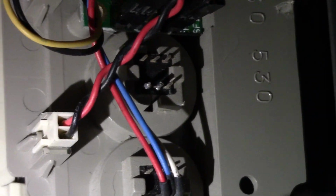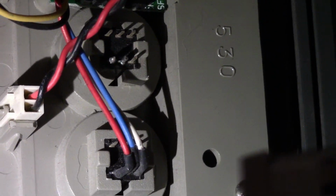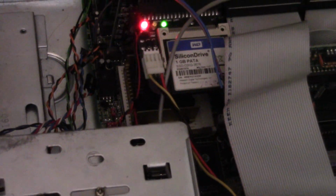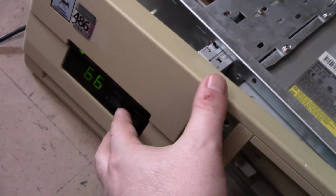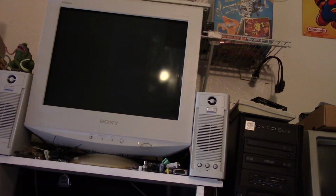I mean, this CPU is just the king of CPUs during that golden age of DOS. It's not really too fast, it's not too slow, it's just the iconic 486, at least in my opinion. And this CPU is going to be powerful enough to play a lot of those golden age DOS titles. Of course there are faster ones. You can get a 133 megahertz AMD 5x86. You can even get a 100 megahertz Intel if you want an Intel 486. There's slower ones, of course, but I just think the 66 megahertz hits the sweet spot for that era.